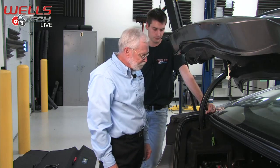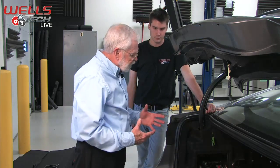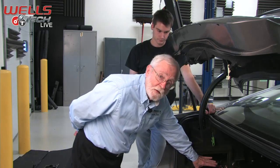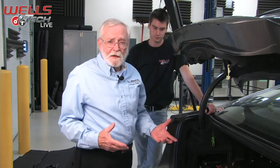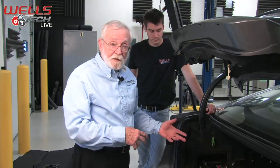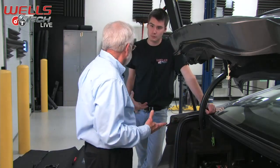Pretty much is. All right, so in the event that we still had a low reading here, like I said before, get out your battery test equipment, load it up, and then make a determination that you're going to have to replace this battery. And in this case, you probably would.